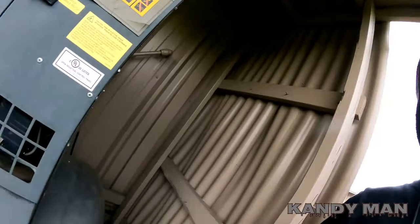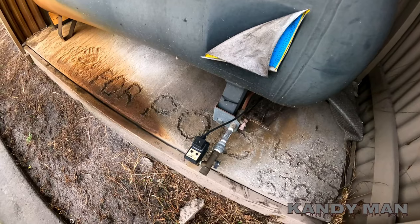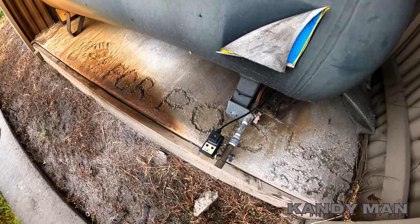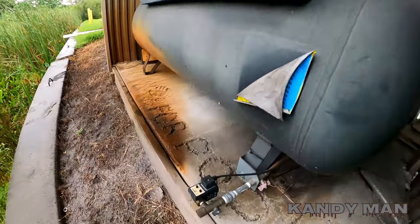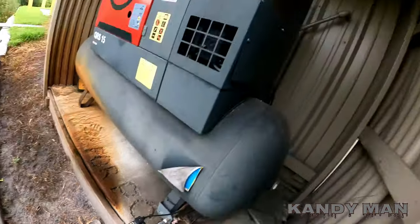So when, you guys see that? That's actually an automatic purge for the water to release out of the tank. So we have an automatic release, and if you guys don't have an automatic release, you'll go ahead and turn the screw off on the bottom of your tank and drain that every day. Before you start painting, after you're sanding something down, if you have a small compressor, because it gets hot. So that's cool that that went. It scared me though. But so we got an automatic release, and it'll spit out every so often. There's a timer on it of how often you want that thing to go off,